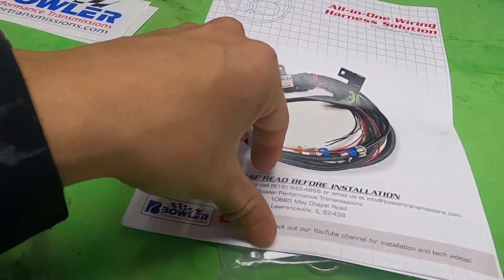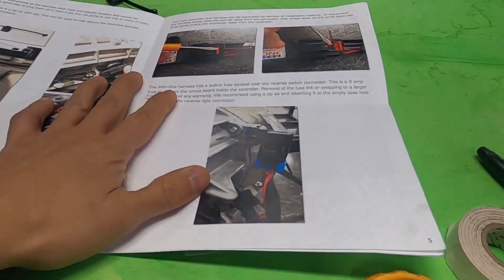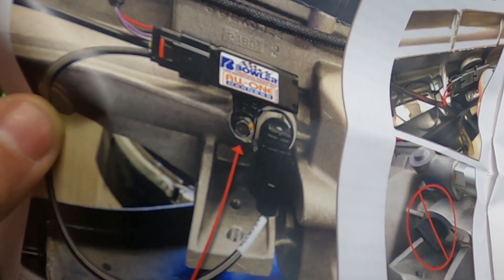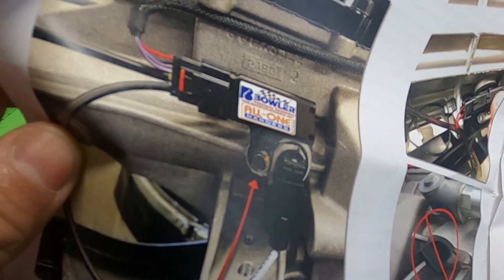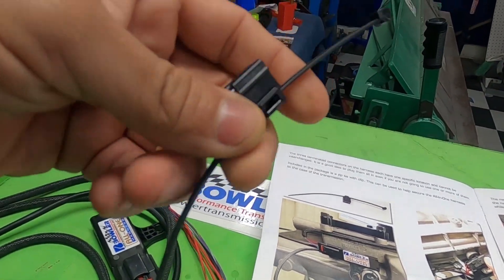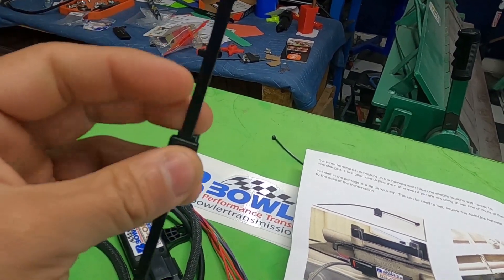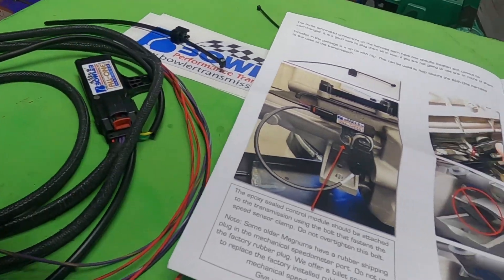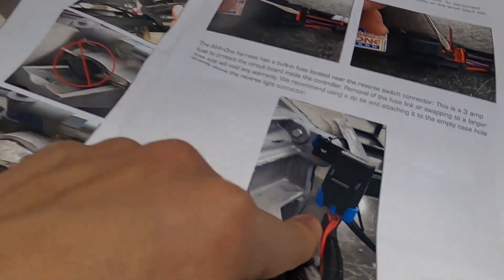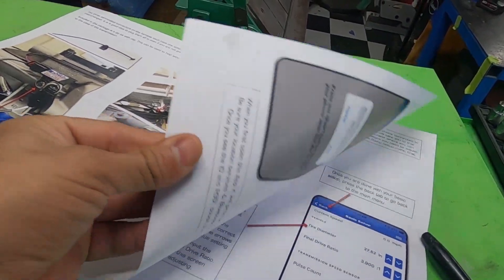Let me show you guys what to expect. It's super simple — plug it right in there, hook up that one bolt to hold the module in place, and then you have a little zip tie clamp that actually crimps to the side of the transmission for cable management. You'll put a few zip ties on it — we'll do that underneath the car.